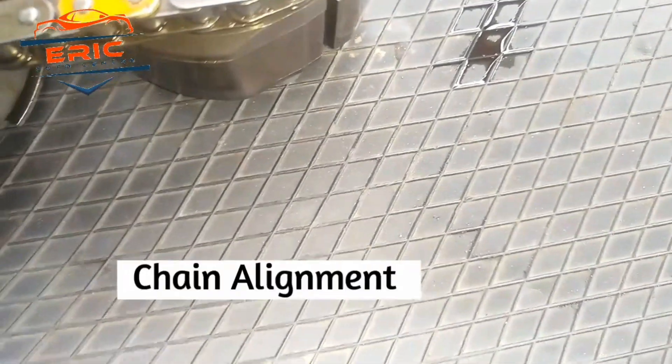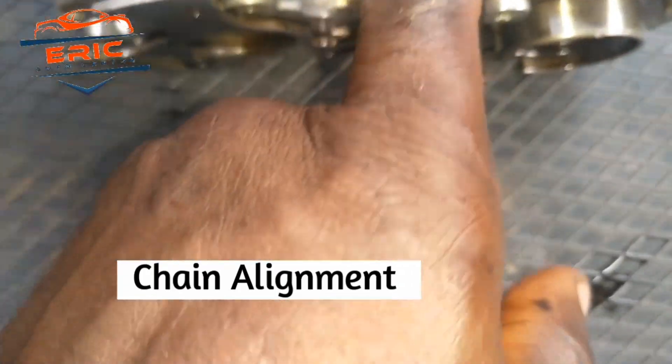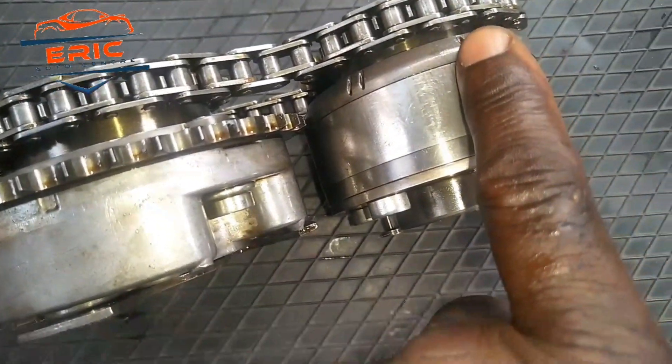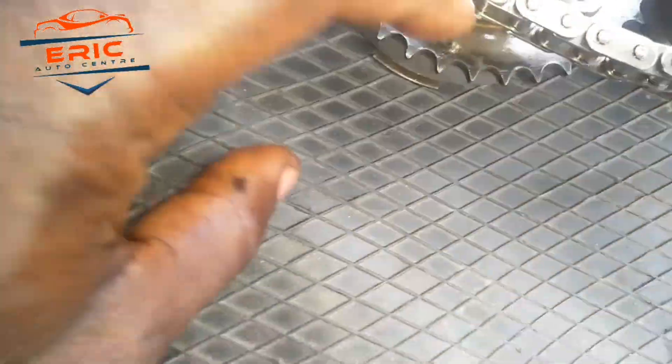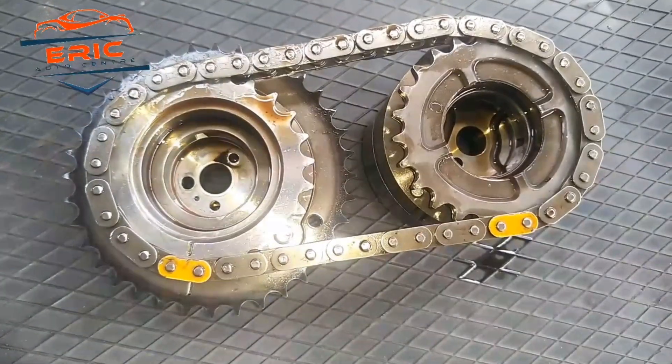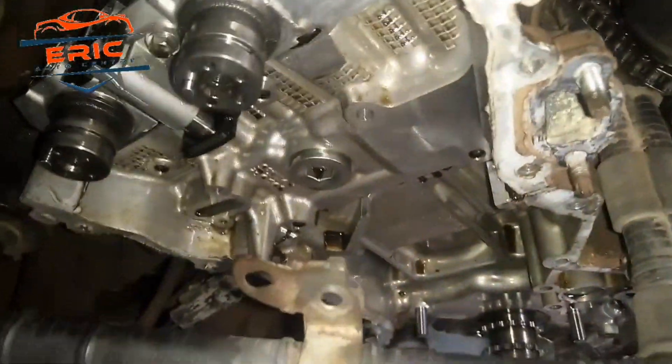Let's go to bank two. I have set the timing chain alignment for bank two. As you can see, this is how you are going to set it. During this time, there is a key here which you have to use, and the yellow mark for the sprocket side. This is bank one — it will indicate like that. And here too, you use this to make the timing chain alignment, which will give you this key here and also inside the shoe as well. This is how you are going to get it done inside to fix it. Same procedure applies for bank two as well.